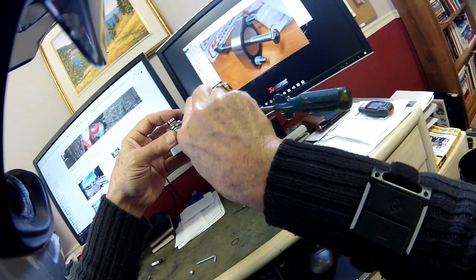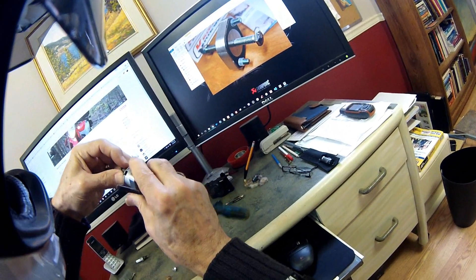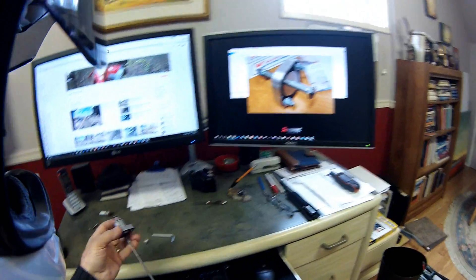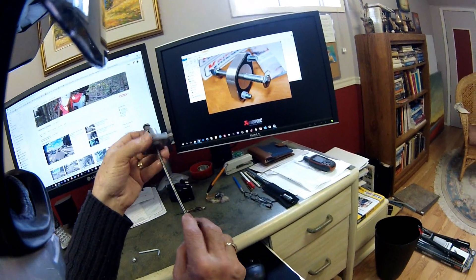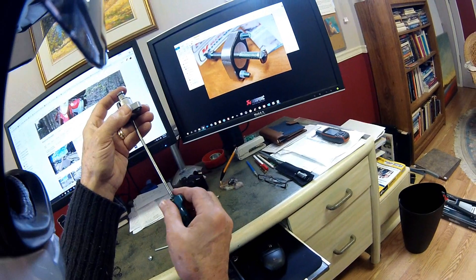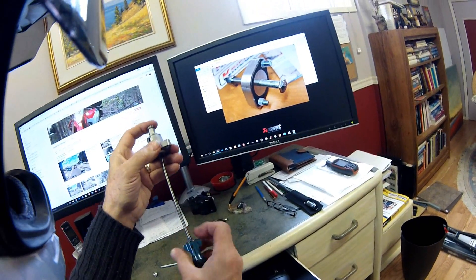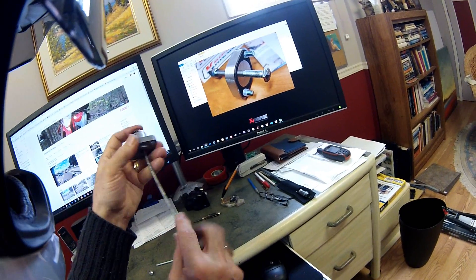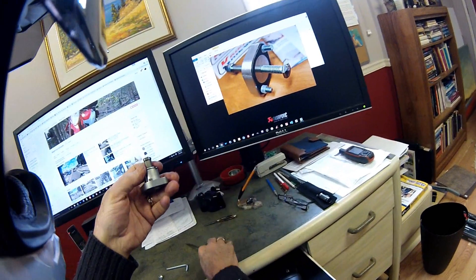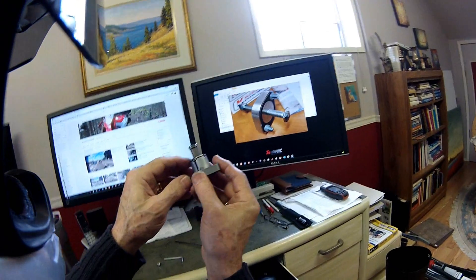The whole premise of that is fine and dandy. However, I think what happens — and this is just supposition on my part — is that when you put it all back together, at the beginning there's a noticeable amount of tension, but as it extends further the tension becomes almost nothing. So I think what happens is when this starts its life in the engine it's fine, but as it wants to adjust it tends to lose its ability to take up the slack in the chain.